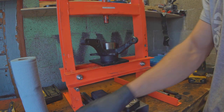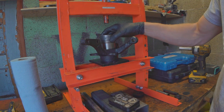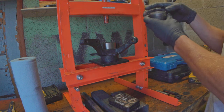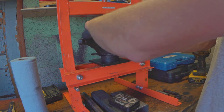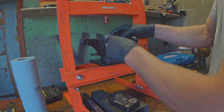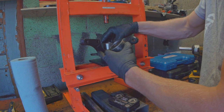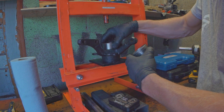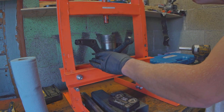You can save your old bearing and actually use that as what you're pressing with — which is what I would recommend. Put your little adapter in here nice and flat-ish, put that on there. You don't want to dress the inside of this bearing where it sits in the hub at all, because you don't want the bearing to come out. You can just leave it all dirty and nasty in there.